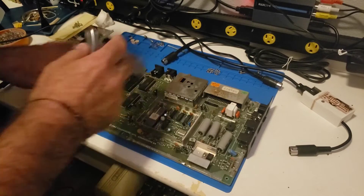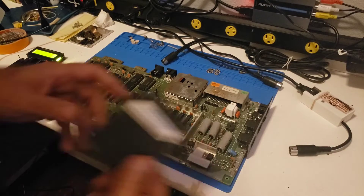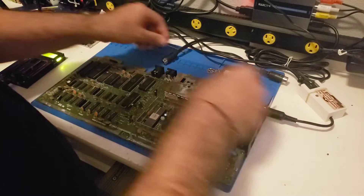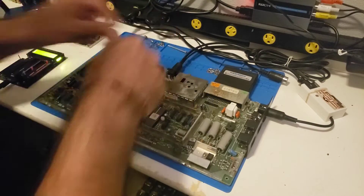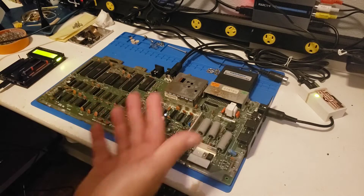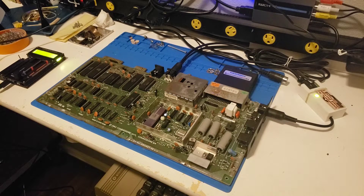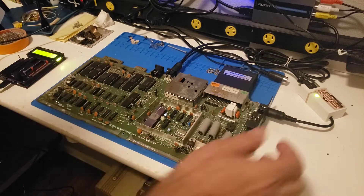Before doing that, let's put the Kickman cartridge in. I won't bother pushing this to the screen, I'll let you know if it works or not. The Kickman cartridge helps me determine if this problem is inside the ROMs or outside the ROMs. I turned it on and I'm still getting a black screen, so we can concentrate outside the ROMs for the time being.